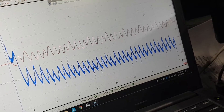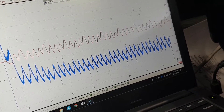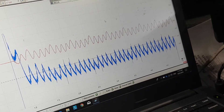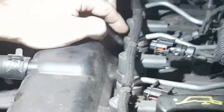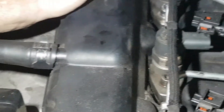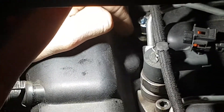It doesn't take much — you can see this one goes to zero psi, so we're only talking about 0.1 psi if you're lucky. But that translates to a lot of smoke and pressure coming out of the oil cap. Something I noticed up here that is probably the cause of the problem: if we take a look at the injectors, we've got the old bolts on most cylinders, but then on cylinder number three, for some reason, there's a new bolt. That shiny one there — I'd say it's a stripped thread and someone's tried to re-tap it.